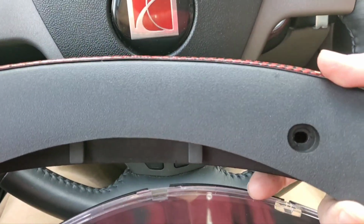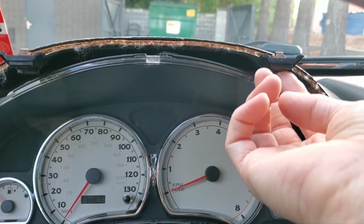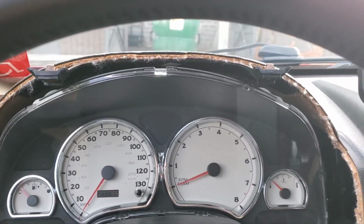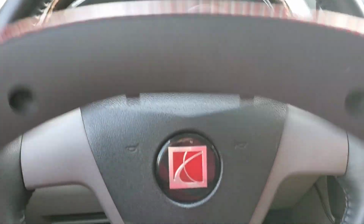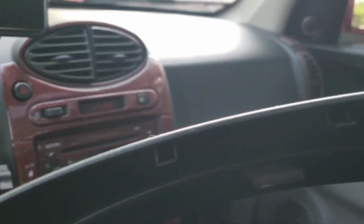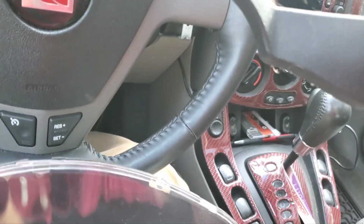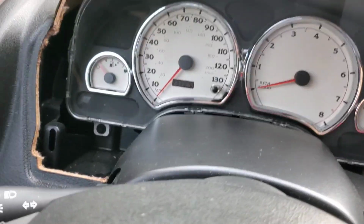With your surround, there are two Phillips screws that are in, they're right up here. That's what they line up to. You'll see me reinstall them, but see, there it is right there. Yeah, that goes in there, and then you just gently pull this bezel forward. It's got little clips, just these little plastic guys that align it, and then your main clips are down at the bottom. So you're going to pop it and then just kind of pull it forward gently so that you're not getting hung up on that plastic surround here.